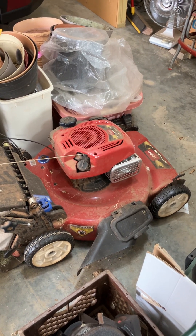The air filter on this doesn't look too bad. On self-priming models, Briggs and Stratton uses a paper filter with two holes — if that gets dirty you have to replace it. But with this foam-type filter, which is pretty clean, you just scrape off the rough stuff, wash it in soapy water, let it dry, and reinstall it. That's a nice money saver.